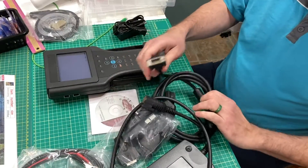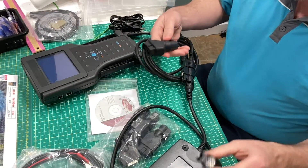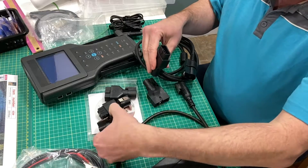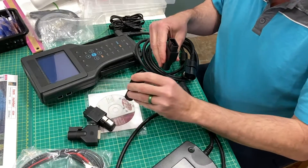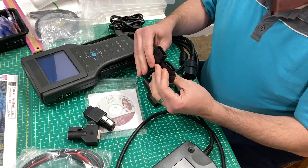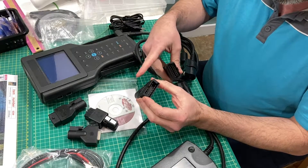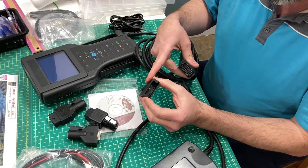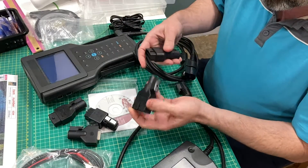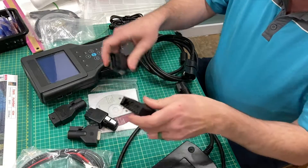This plugs into the bottom of the tool and then the CAN module goes in line — this would be the male side and then you'd put your OBD2 reader on that. There are different connectors; some cars may also require power. This is my OBD2 port and this is my OBD1 port — it can do limited OBD1, though I haven't explored that much. I've got lots of OBD1 cars so we'll plug it into everything once we're more comfortable with it. You can see it's not using all the pins — they set their own custom pinouts so the tool can plug into a variety of things.